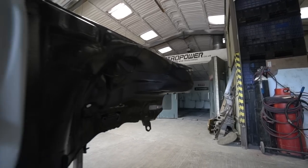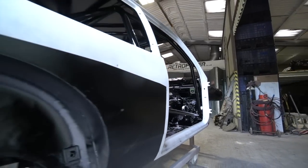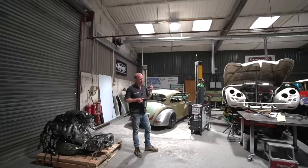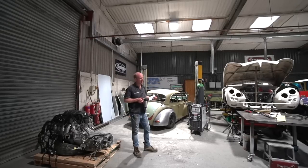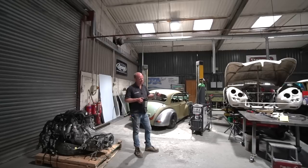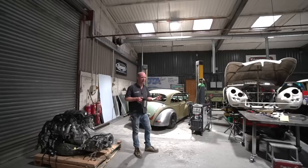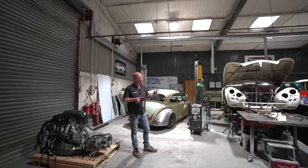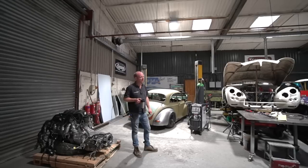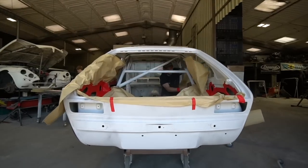So he's done that. He's then raptored any internal cavities that needed it, which is chiefly the inside of the rear quarter panels. That gives us an amount of sound deadening without putting sound deadening in there, and seals up any small seams that are very high, which are sometimes hard to seam seal. The seams in the wheel arches, for example, are sealed from the underneath of the car anyway, so there's not really much point sealing them from inside the car, but if you raptor inside the quarter panels, that seals them anyway, so that does quite a neat job. So he's raptored inside the quarter panels.